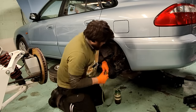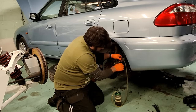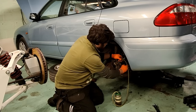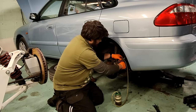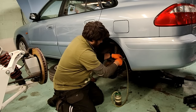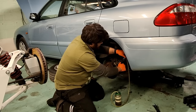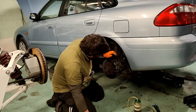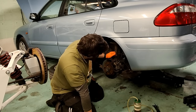So, right, so I've got my jam jar. So what I'll do is I'll hold it, release this, which means it's not a hydraulic problem, which means they've put a new caliper on it, but it must be caliper related.